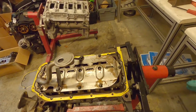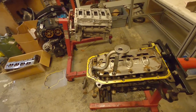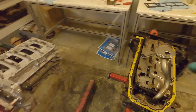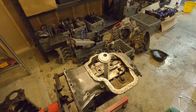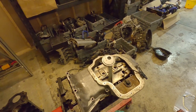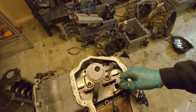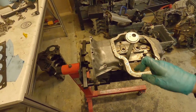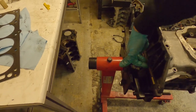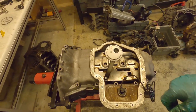Just take your time every time you put the gasket on — look right around to make sure it's correct. It's very easy to put some on the wrong way around, get halfway through installing it, and find it won't fit. So get your gasket, get your sump, and put the sump on. One thing to note: many engines have bolts inside the engine as well as outside. Make sure you get all your bolts on the outside but also don't forget the ones on the inside. This particular engine has three extra bolts inside, and some different length ones that go all the way through in another direction. Have a good look around — there's usually some hidden ones somewhere.